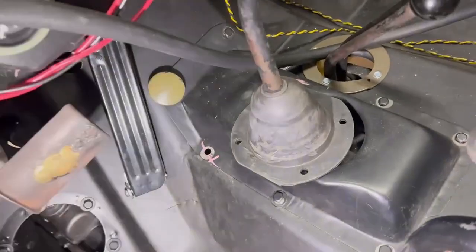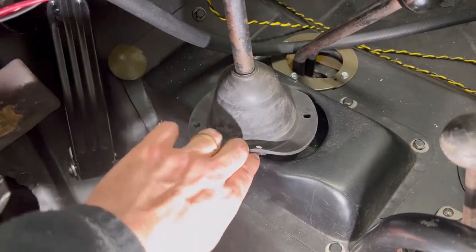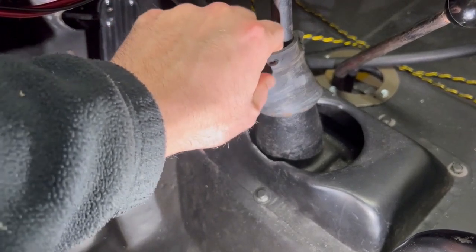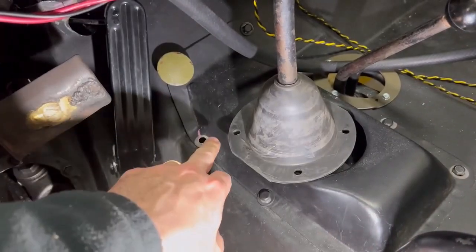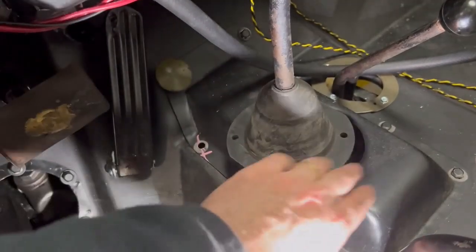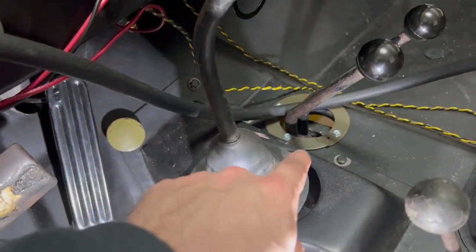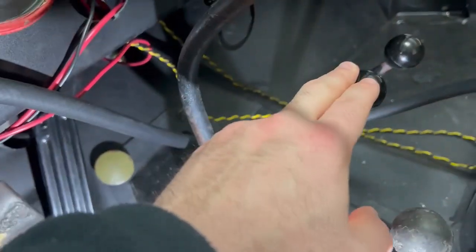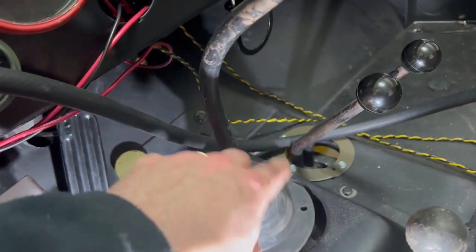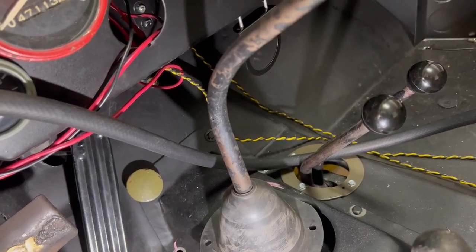I made my own little plate underneath the factory plate where the boot is, and used nutserts to get it in place. On the transmission tunnel, one of the bolts I actually had to eliminate — it was in the way. You'll see the cuts I had to make into the transmission tunnel — way off. I'm going to fill that bolt hole with weld and shape up a new tunnel cover using the existing one as a baseline. I also had to cut a bit more into the body for the transfer case, but the bracket that goes around it should cover what I had to do.